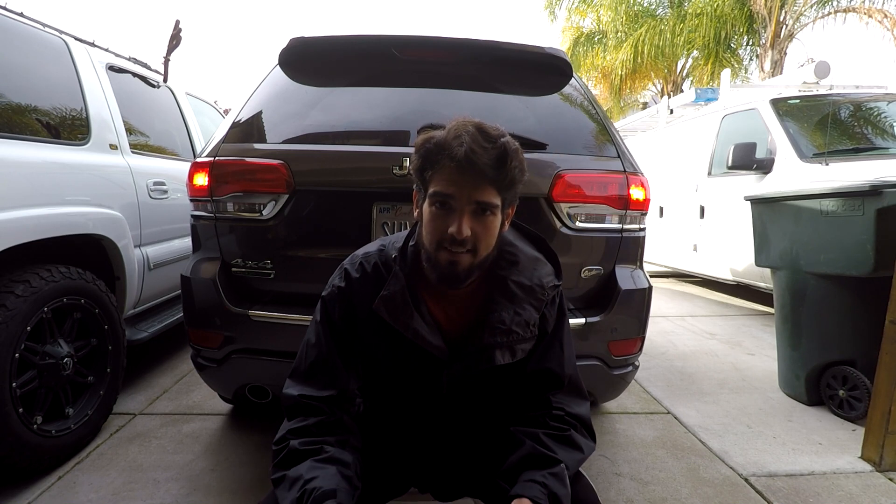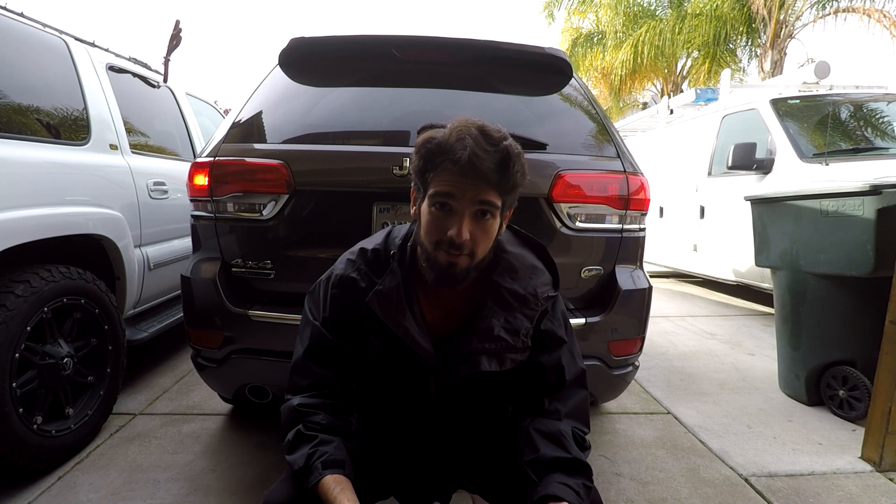With this little modification, we're actually going to be keeping the existing housings and all we're doing is changing out the bulbs. I'm going to show you how to very easily change out the light bulbs to LED ones that I picked up at AutoZone or any auto parts store, and then I'm also going to show you how to really easily install some resistors to help prevent any hyper flash issues that you can get in this vehicle and in many other vehicles.